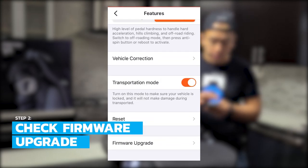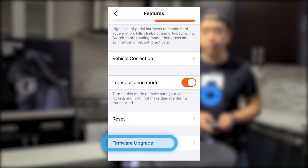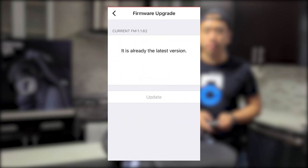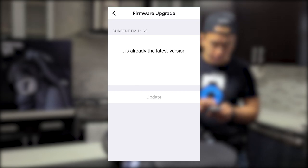While we're here let's upgrade the firmware. To get the wheel ready for firmware upgrade, make sure it's powered on, then engage the handle kill switch to lay it down on its side on a flat surface. In the app, let's go to the firmware upgrade — if it's already upgraded it'll tell you that. If not, click on the update button and follow the instructions. Once it's ready it'll download the upgrade and transfer the file over to the wheel. Once it's finished, just power off the wheel and power back on.